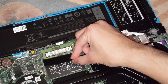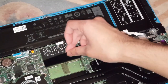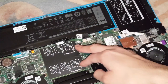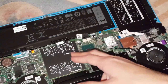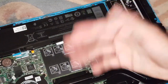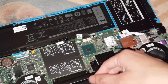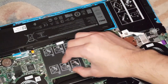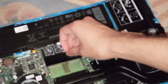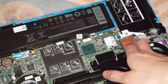If you're going to upgrade your RAM, just take these covers off. I think I have two four-gigabyte sticks in here — yeah, two four-gigabyte ones. The way you get them out is you squeeze in the corners and then the stick pops up. There's a notch to line it up when you put it back in. I've got two four-gigabyte sticks in there. To reinstall, you line up the notch — there's a tiny dot right in the middle of the slot — same on the other side.